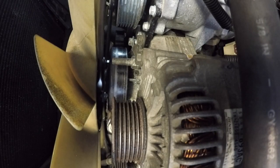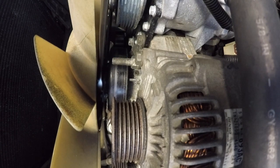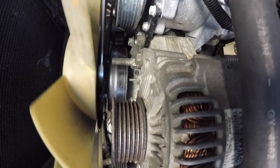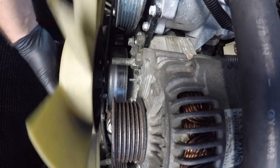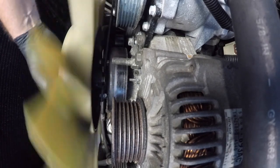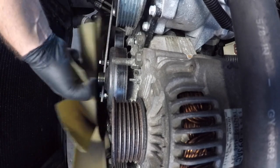With the fan pulley locked in place, use a 36mm or 1 7/16 inch spanner on the clutch fan hub and rotate the spanner to the left. With the pulley locked into position, the tension on the threads can be easily freed. Once loosened, you can then rotate the fan by hand to remove. And this is job done.